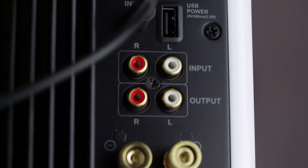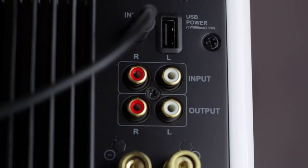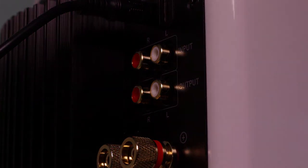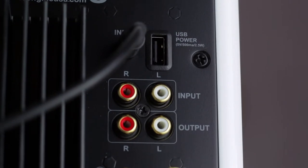There are also some outputs on the back. You might wonder why speakers would have outputs — that's so you can connect a subwoofer, such as the Audio Engine S8, for extra bass punch. Above that are a couple of RCA inputs, as well as an aux input just above those. Next to the aux socket is a USB socket, but this is only for USB power — not USB playback, as there is no DAC in these speakers.